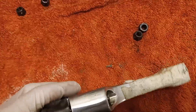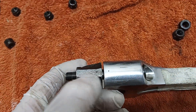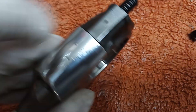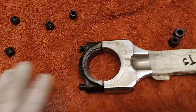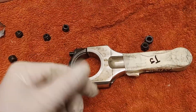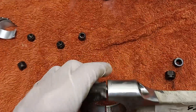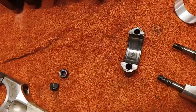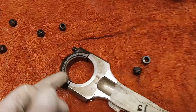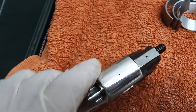As I mentioned during dismantling, there are center punch marks on the sides of the conrods and their caps. Those punch marks must always align and always be on the same side. When someone previously reassembled this engine, they had one of the caps around the wrong way. I'm not exactly sure what effect that would have had, but it wouldn't have been good. Even though the shells were pretty new, there was definite wear on that side from being fitted the wrong way around.